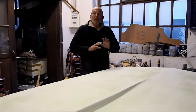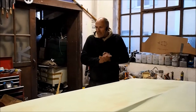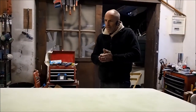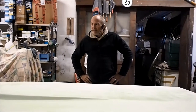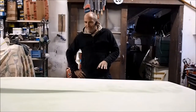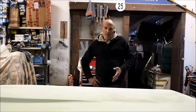Finally, it took a while. The entire bottom will become ivory, beige, whatever you wanna call the color. I think actually it was ivory white. Then we'll take it from there. I think we'll just get two coats of ivory on there today, then let it dry, put the hardening lamps on overnight, and then tomorrow we'll give it a coat of clear coat, or two coats of clear. Then it will stay for a couple of days to get really solid before we turn around, so we don't get any press marks when it's standing on the paint and we start working on the top part.